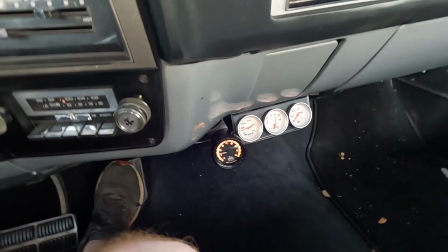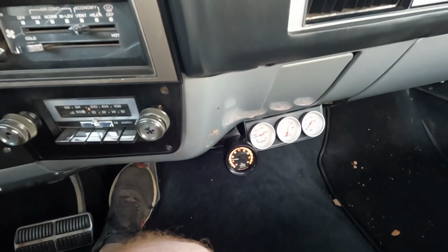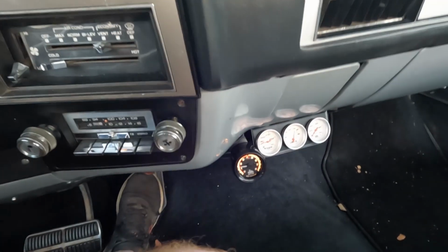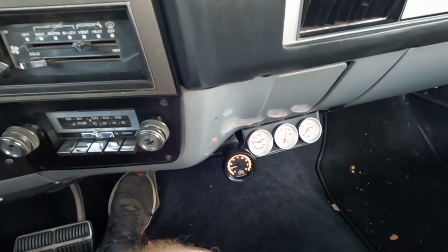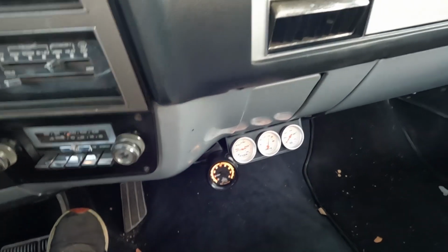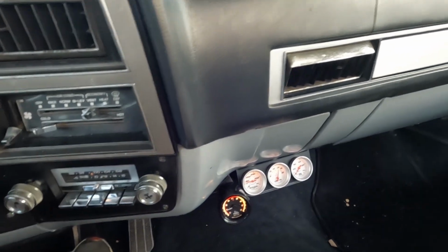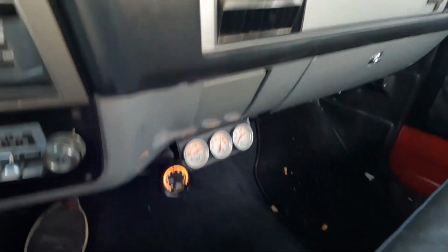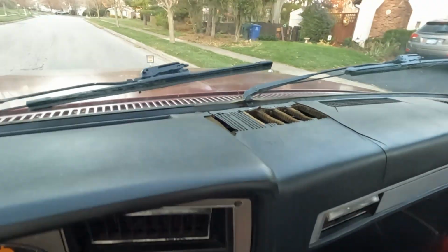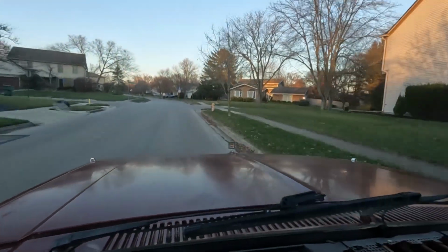But the only thing I couldn't do was improve where I was on the vacuum gauge. No amount of turning really adjusted it too much. It either started getting worse or it stayed around that 10 to 15 range, which basically says late ignition timing on the gauge. But again, I don't know if that's because I didn't have a good seal on there or not. But she's definitely running better. Sounds good.